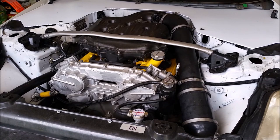The first time I drove the car without any of the heater hoses on it, the thermostat did not open and the car started to overheat. You could simply remove the thermostat, but the problem is you let too much coolant flow and it won't spend enough time in the radiator — you actually overheat because the coolant is moving too quickly.